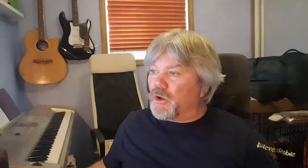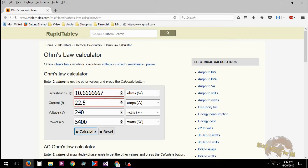The dryer is rated at 5,400 watts and the heating element is probably a 4,800 to 5,000 watt element. I've got a calculator on the computer here and we're going to look at how changing the voltage of a resistive element impacts the current or wattage demand. The element is rated at 240 volts pulling 5,400 watts. Clicking calculate, we see it pulls 22.5 amps and the resistance of that coil is a little over 10.5 ohms.